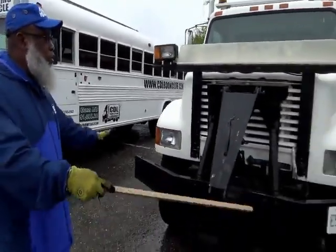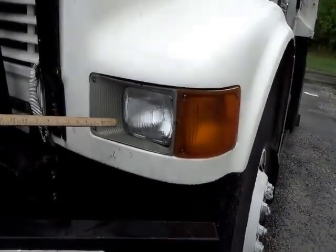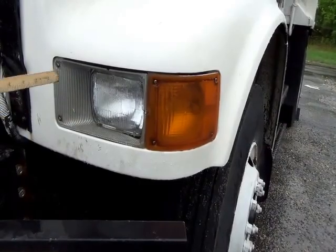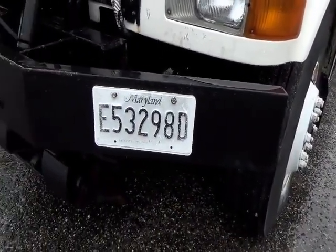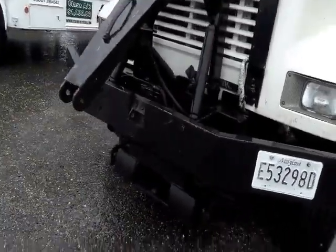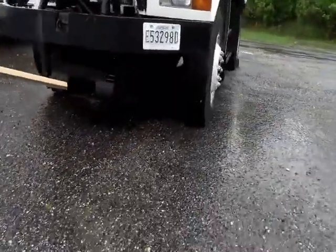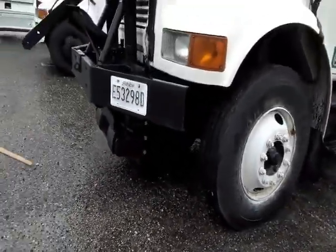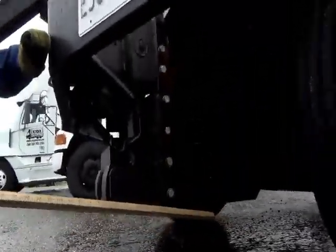Okay. Then you move down to the headlights. The headlights are not cracked, not broken, and secure. They're clean in color and no condensation. The tag is properly secure. No outdated stickers. Now, my tires are properly inflated to the manufacturer's specification. Now, underneath the vehicle, I'm checking for any leaks or puddles or loose or hanging wires.